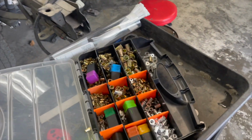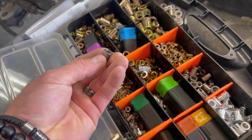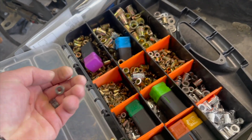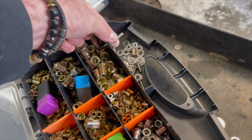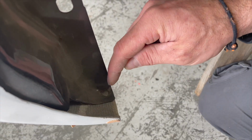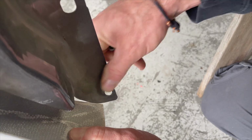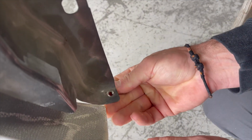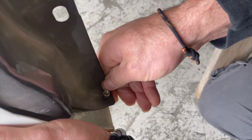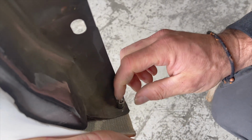This is what we're gonna use. Actually, I don't know how many of you saw the Mustang video. I did the wide body, but that's the rivets I'm using. You kind of install this and then using those little bolts with some washers. That way, when you need to remove this panel, it would be easy. What I'm gonna do is put a hole into the panel and then install the threads this way. And when you wanna pin the panel, you're just gonna go like that and put the screw into the bottom.